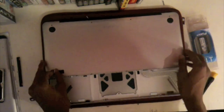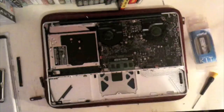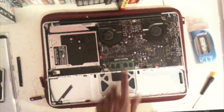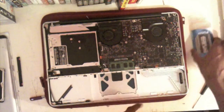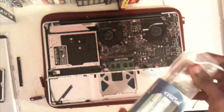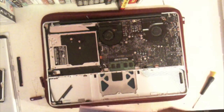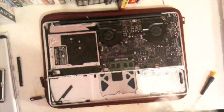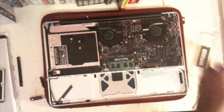Now you want to remove the back of the laptop — and there's the inside of your MacBook. The RAM, as you can see, is here. I'll open up the new RAM and take it out of its package — it's simply two sticks of 2GB RAM. I'll take those out of the plastic and put them to one side.